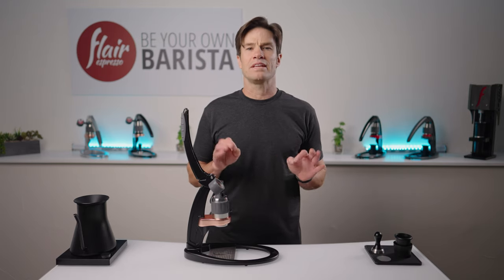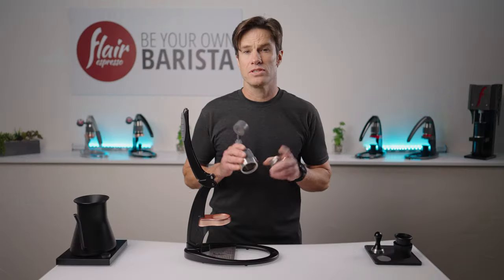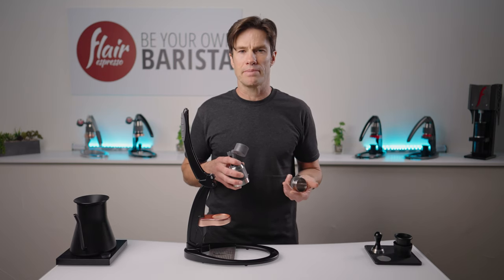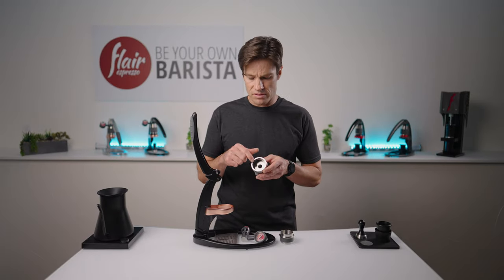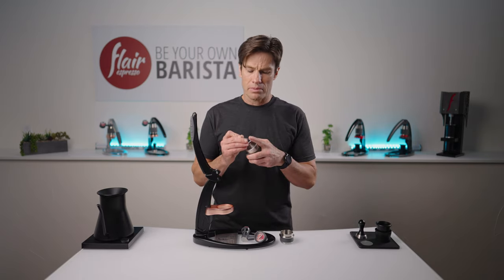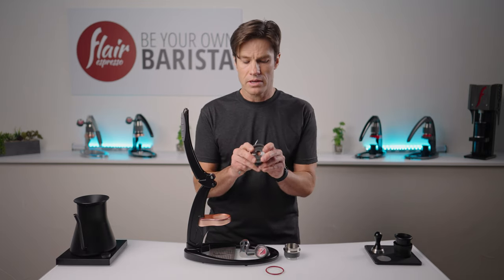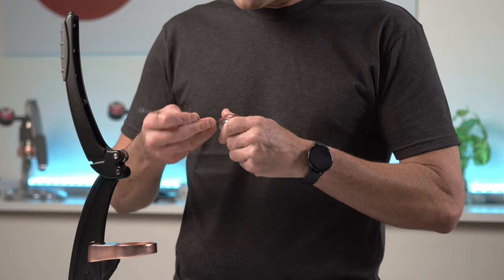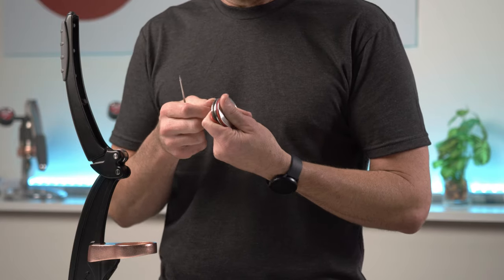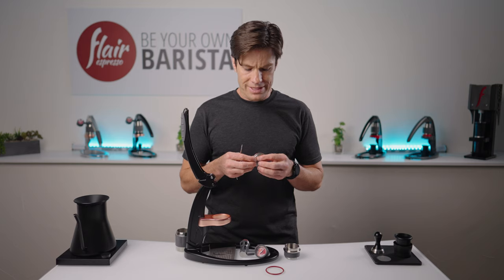Like all Flairs, maintenance is next to none, thanks to the patented removable brew head that provides you unfettered access to the entire brew path. Just a quick rinse under the sink after every use — leave it out to dry — and you can skip all the pesky back flushes, descales, and special cleaning powders that other machines require. Depending on the frequency of use, every couple of months or so, remove your O-rings and see what might be hiding back there. Use an implement that's not sharp so you won't damage your O-rings. Pull the O-rings out, then push out your plunger, and just wipe back there with a paper towel. We don't recommend detergents because any residue left behind can be an off-putting taste in your espresso.